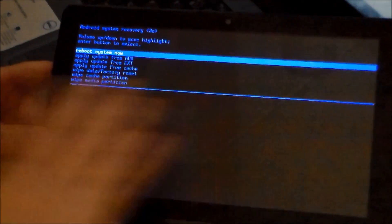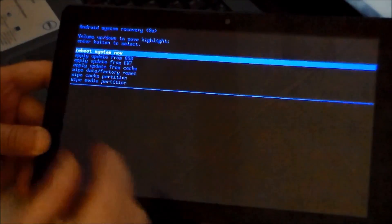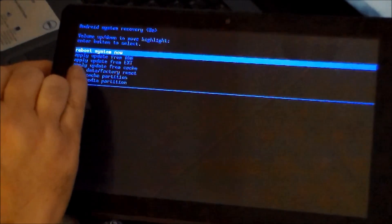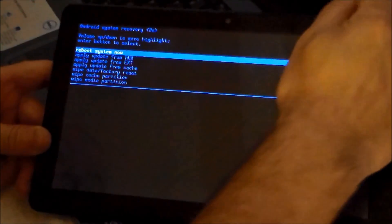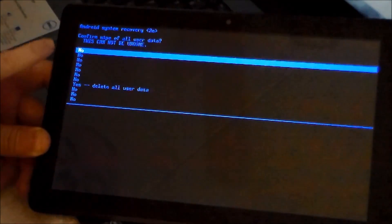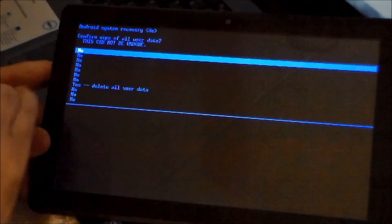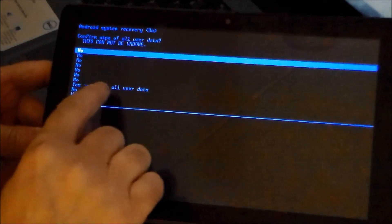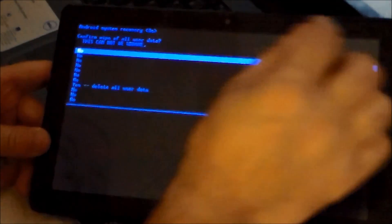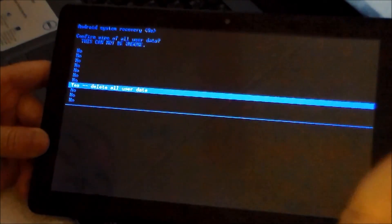Once you've done that and it's on this screen, you know you've made it. The tablet's okay, it's going to come back on. If you can get to this recovery screen, the A9 dual core thing will go away. Just make sure that you do the wipe data factory reset. You're going to go down to it and select it. You see all these selections — scroll past all the no options and select yes — delete all user data. Go there, pick it, toggle down to it. Hit the power button to confirm.